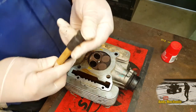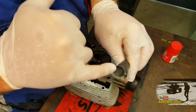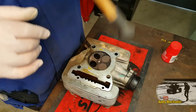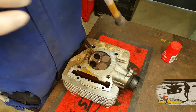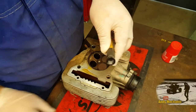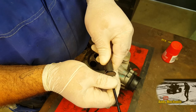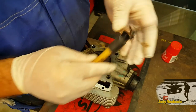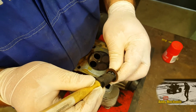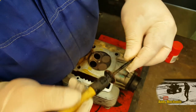Right, to the head. I'm doing this a bit off camera, but what you need to do is put some spit on the end of the rubber sucker. It's a very technical thing — all the workshop manuals say a bit of saliva on that rubber. There we go — the mechanic's spit. Get your valve, valve number one, which came out of exhaust valve hole number one. Stick that valve on the end of the rubber. If it doesn't stick too well, you may need to sand the head of the valve because of carbon buildup, but if it does stick — there we go, cool.